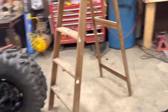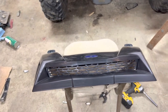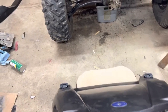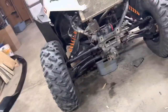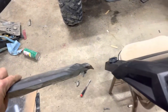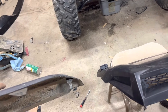And the same on this side so the radiator doesn't rub up against the hood. With the hood, what I had to do — it normally has a regular hood on it — I bought an aftermarket turbo hood. One, it gives me airflow through here that will help keep the radiator cool. And two, the stock hood is kind of flat — compare these two — the turbo one sticks up and gives the corners of that radiator space to come up into.